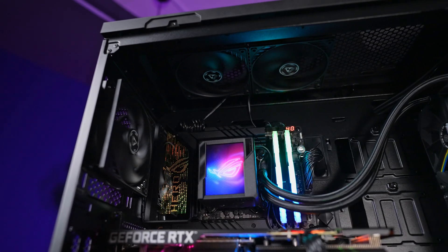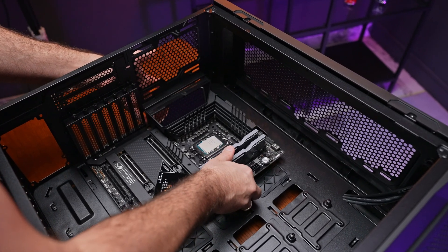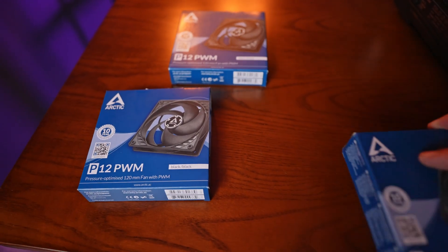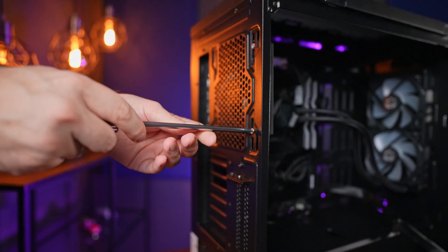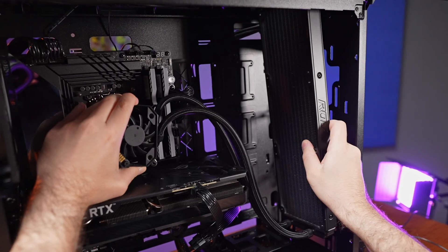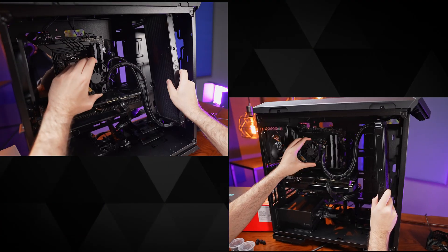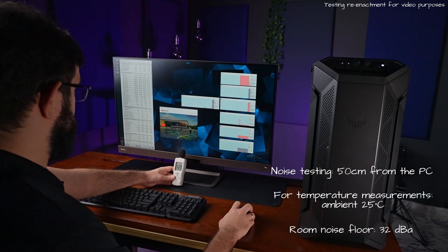Let's now jump into performance metrics. We are using the top-of-the-line i9-12900K for these tests, left at stock settings with multi-core enhancement turned off. This particular case does not come with any built-in fans, so we installed three Arctic fans at the back and top for exhaust, and used the front position for the AIO coolers. Ideally you want the radiator to be the highest part of the loop with tubes running down, leaving space at the top for any trapped air — this improves longevity, though it may not always be possible due to specific case configurations.